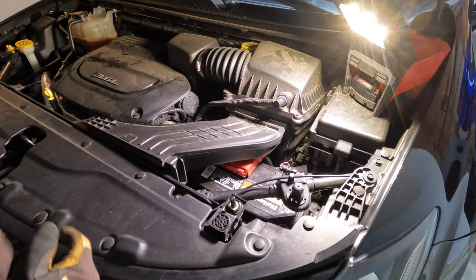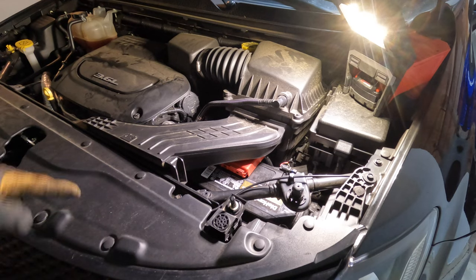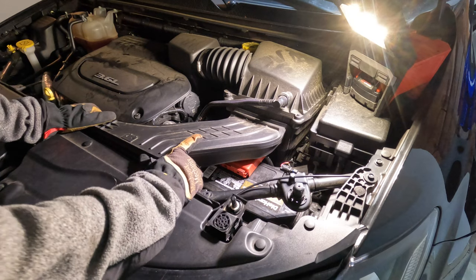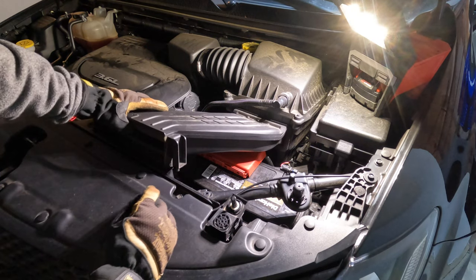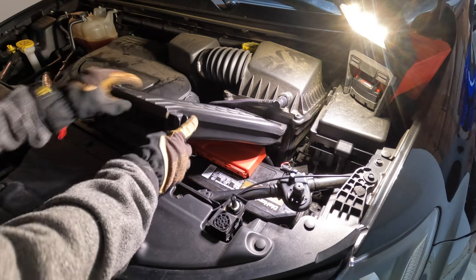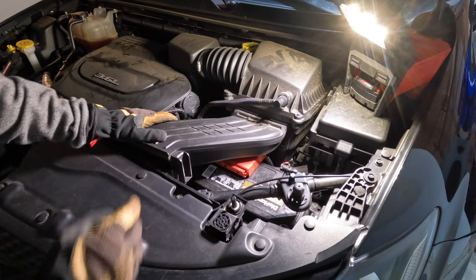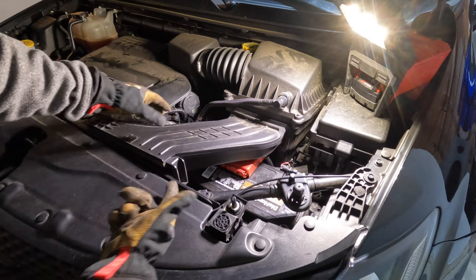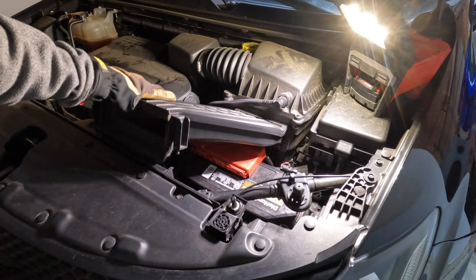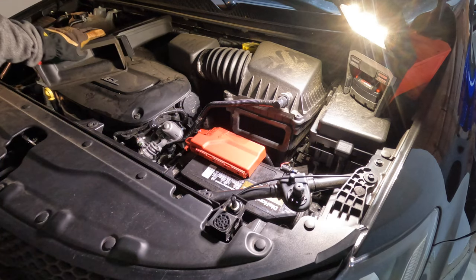What we have here is the air duct - this channels air from the grill to the air box. The air duct just sits in here with these little pops, a little grommet and a little plastic nub on either side, and you are going to need to remove this to get to the battery. Mine doesn't really sit in there flush. You just put a little bit of force, pop that out, lift this up, and this will pull right out of the air box.